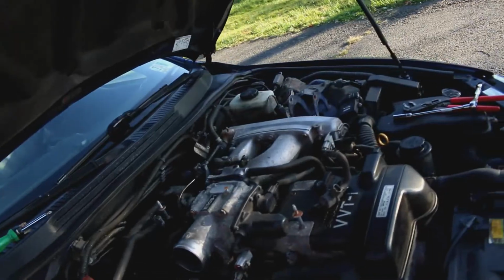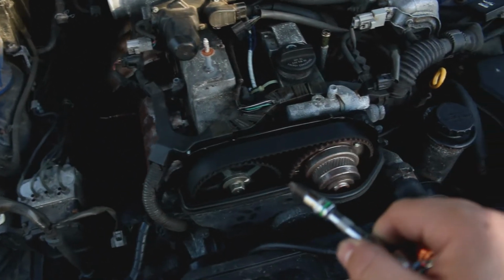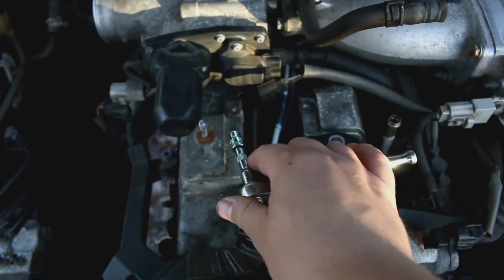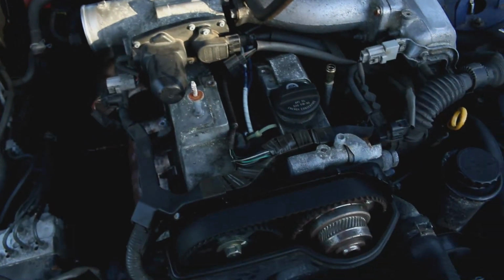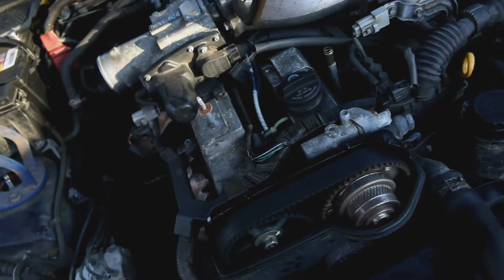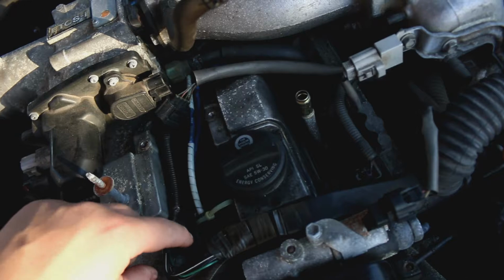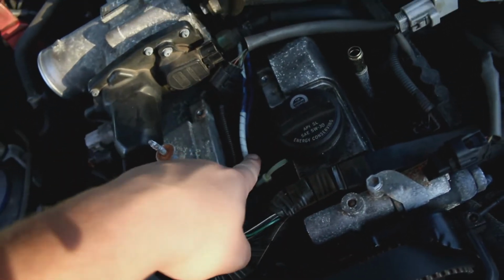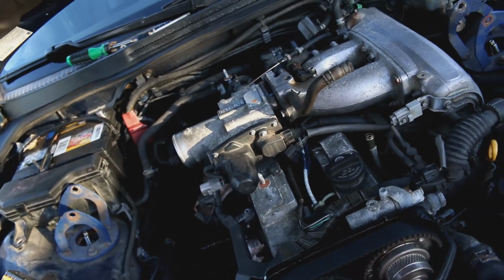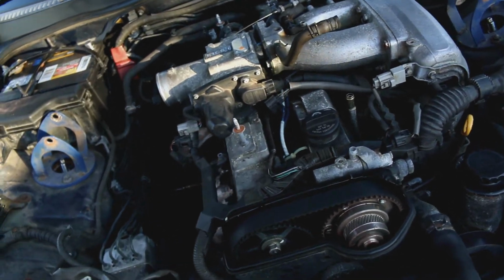Oh, this guy. So we got the engine cover off. It was pretty straightforward. It was just 4 hex nut type things that were holding it on. One here on either side and one towards the throttle body right there. Once we pulled this off, it literally just came straight up. But we wanted to point something out too. It looks like someone actually went through and upgraded the electrical system on this car, because those are NGK wires. As far as I'm aware, they didn't come with NGK wires, so kind of excited to see some quality parts on this car. But we will need to pull up, obviously, the throttle body at least to get into the rest of it and see what's going on. That way we can actually start taking these plugs out and see the condition of them.